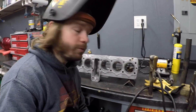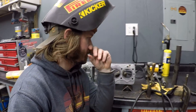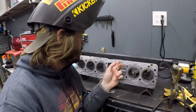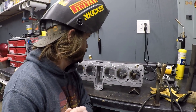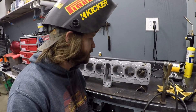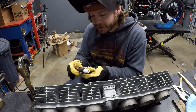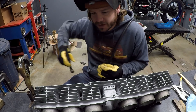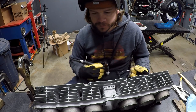The first test spot went really well. I'm using a 4043 filler rod and the TIG is set up at around 120 amps - not that I'm getting anywhere near that high. One pass to clean it up, then just started filling, and it wasn't too bad. I'm just going to build these up with pure filler rod rather than doing any kind of patch panel. I'll do a little bit here, let it cool off, then go back through. I have an older transformer machine - a Miller Syncrowave 180 - so no pulse or anything like that, very limited adjustment, but I'm getting better at welding aluminum.